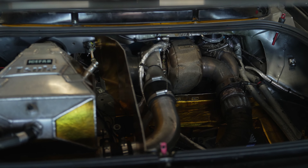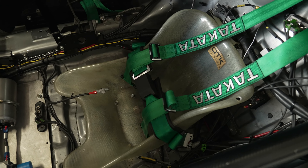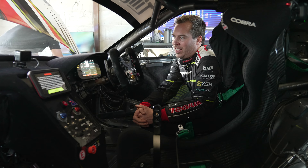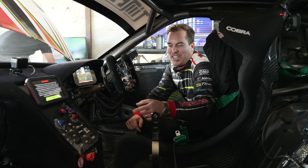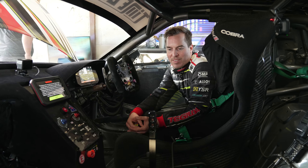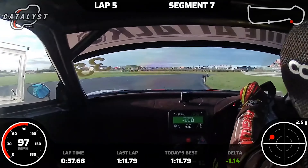As you can see inside the car, we've got the usual safety features — a Takata harness and a Cobra ultralight seat. Something that's a bit unique to Time Attack is you have to have a passenger seat. The rules don't specify what passenger seat, but you just need one, so obviously we want the lightest go-kart passenger seat we could find. We use a Garmin Catalyst for lap timing and driver data, and then we've got an AIM dash. You can see in the passenger footwell it's quite full — that's all the air system for the pneumatic gearbox, as well as we control our blow-off valve and wastegate with air from that as well.